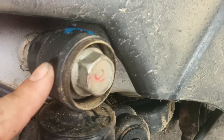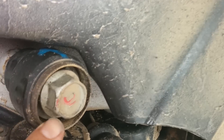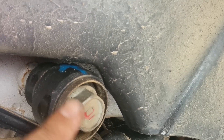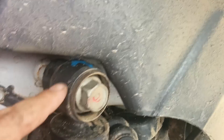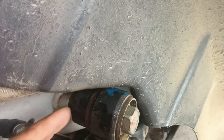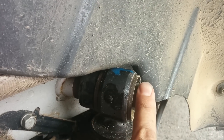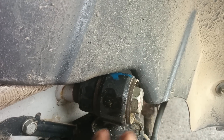If you look inside, that's the shock retaining ring or washer that's on the other side of this bolt, but it's not retaining this at all. This shock is actually walking right off of this shaft. This bushing disconnected itself from here — there was nothing to stop this shock from coming right off the vehicle.